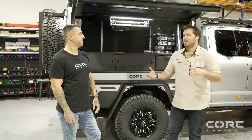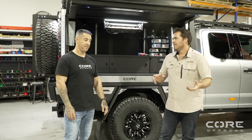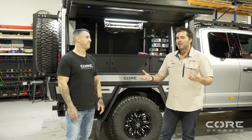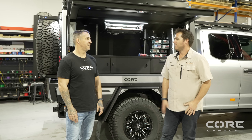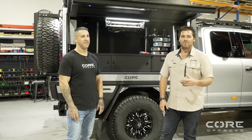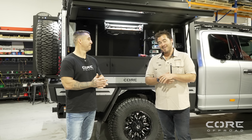Even with those vehicles you're still going to have to upgrade the rear coil — you need a big rear coil to carry that constant load. The one variable with a coil rear end is you can let the airbag down to try and make the ride a little nicer, but even still, a Ram 2500 or 200 Series with a 500-kilo constant load on the coil in the back — it's going to be stiff. You cannot deny that.